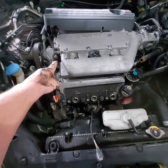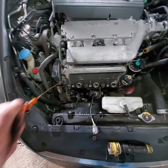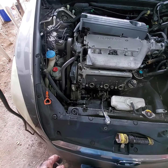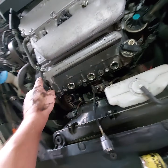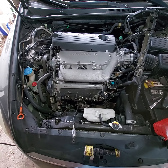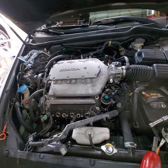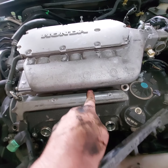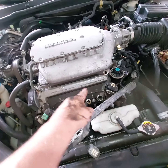All I've got to do is take this vent tube off, pull the dipstick out, and four bolts, and I believe that valve cover comes right off. Well, sometimes it's fourth and long and you have to punt. There are two bolts back in here I didn't see when I looked. So that doesn't come off — we have to take the intake manifold off.